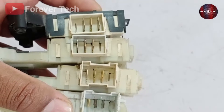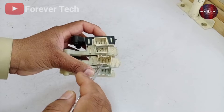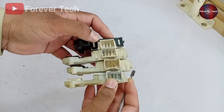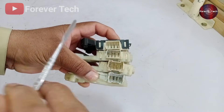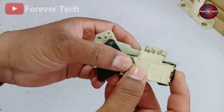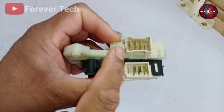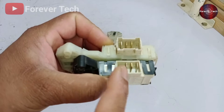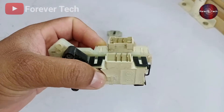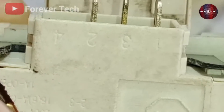This is a big difference — if you don't understand it, the door lock will become faulty, and the PCB will be damaged if a short circuit occurs from faulty connections. It's necessary to check the position of terminals: left to right or right to left. I'm holding two door locks — every company prints a number on this type of switch. These door locks are different: one is right to left, the other is left to right. Each has three terminals and the fourth one is empty. You must read the numbers carefully on door locks.